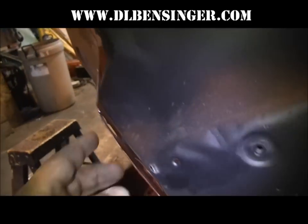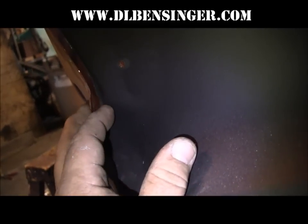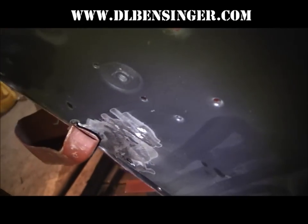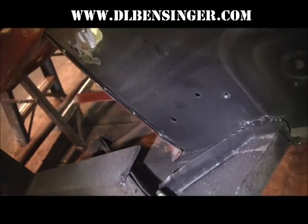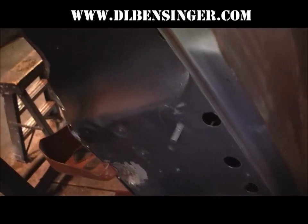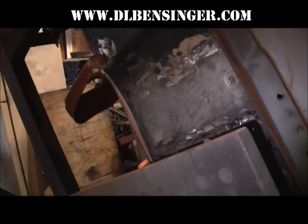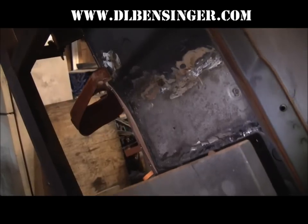We have a little issue here. We may have to do a little heating to pull this in. Might have to heat the metal there to reform it a little bit with a hammer to get that in. But again, pretty close. We're tight there. All that'll clamp or bolt up pretty well. So we're fitting pretty good all along the firewall. That looks pretty decent. Now, the other thing we've done